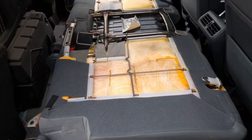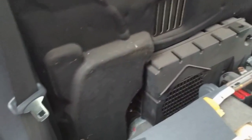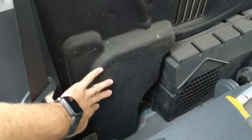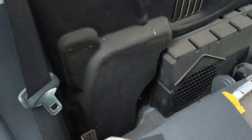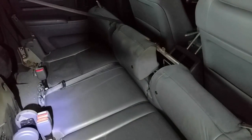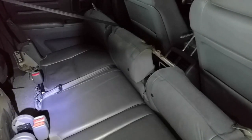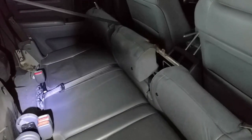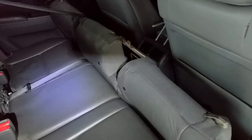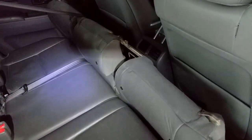I've laid the top of the rear seat flat onto the bottom of the rear seat. The next step is to cut away this piece — this houses the XM tuner and that's what we're going to need to connect to. One thing I haven't mentioned: if you haven't yet disconnected your battery, go ahead and do that since we're going to be cutting and connecting to the stereo. I've also found it works out nicely to lay the top of the rear seat down between or behind the front seats to get it out of your way.